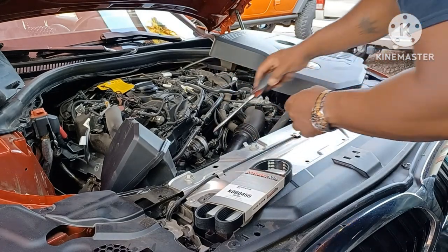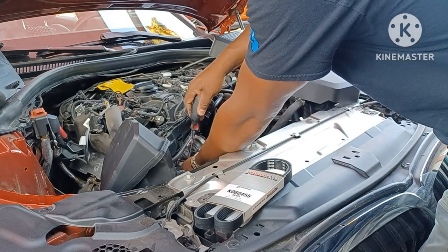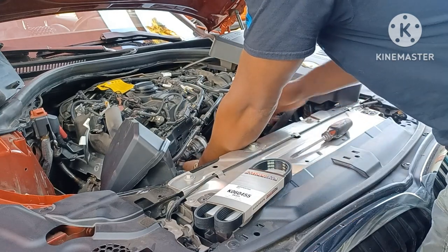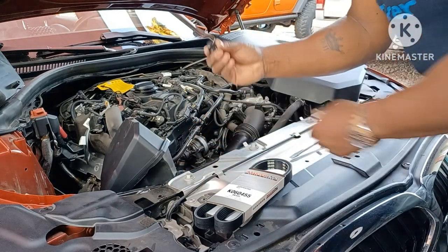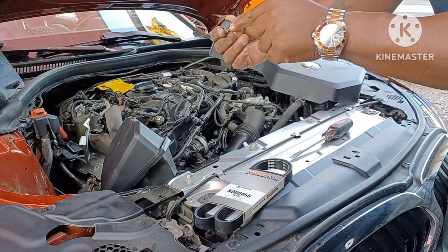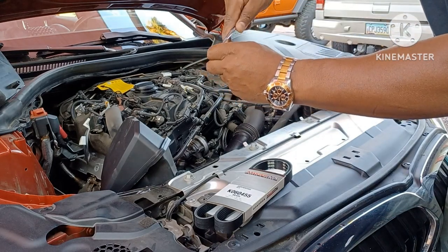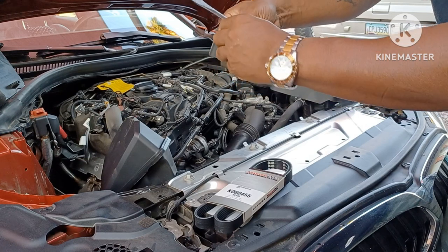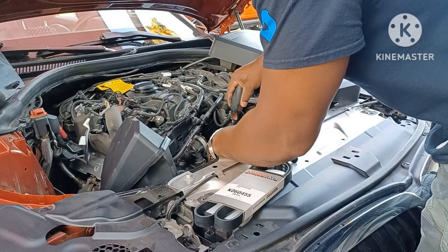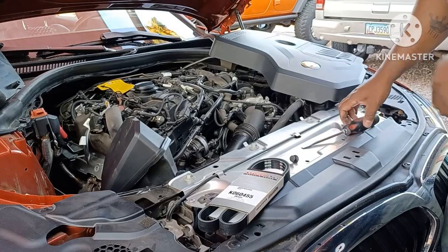There are little plastic caps — little plastic notches that hold the cover on. I'm going to get my flathead in there and scoop them a little bit. What it is: this piece is pushed in, so get the flathead screwdriver fitting in between and pry it apart. Rock it back and forth lightly so you don't break the tab — slides right up. Looks like I've got one, two...